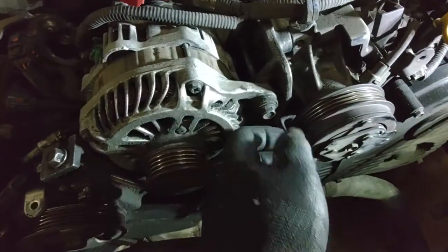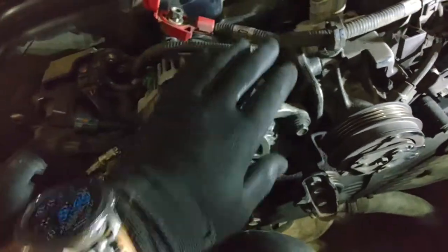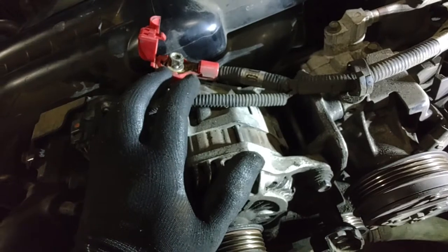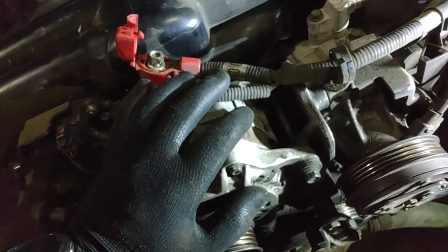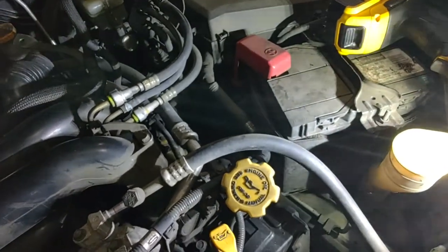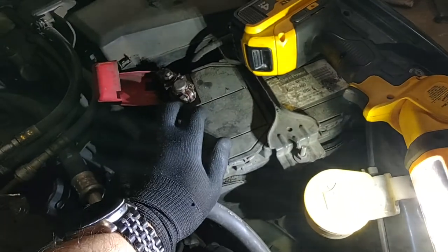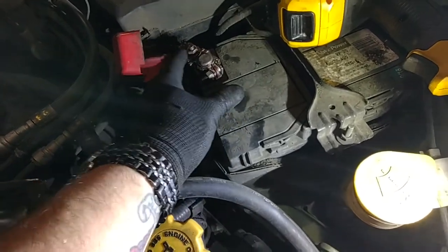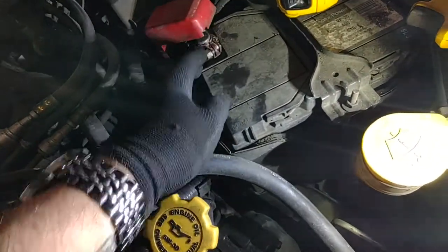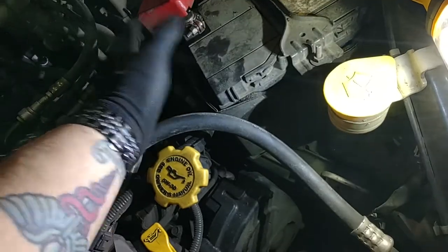Let's get to the meat and potatoes. After removing the cover, there's a 12mm bolt with a thin washer — we'll take that out. But first, disconnect the positive terminal. It's a 10 or 12mm nut depending on your setup. If you leave the main contact wire free without disconnecting the battery, it will spark if it touches any ground. I hate losing my radio presets, but you really should disconnect the positive terminal, pull it to the side so it can't cause any damage.